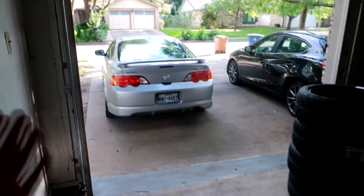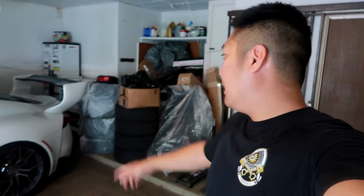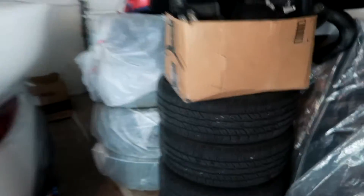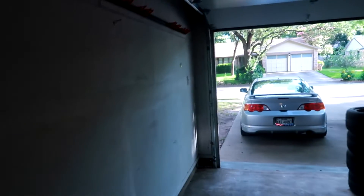For four new NT05s you're looking at almost $800. I did size up from stock — the stock tires were 215s on 16-inch wheels, and I went to 235/40/17s. Even though the stock tread was still decent, I wanted more grip, and the NT05s definitely delivered — really confidence inspiring. But unfortunately the rear tires came pretty bald when I got the wheels used.